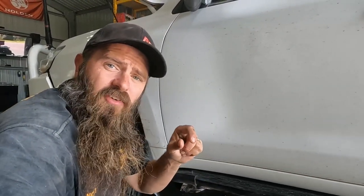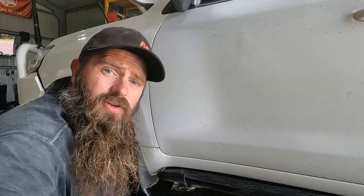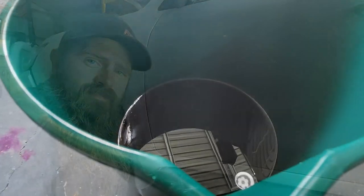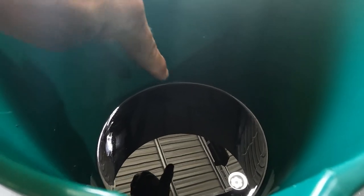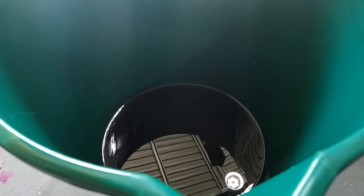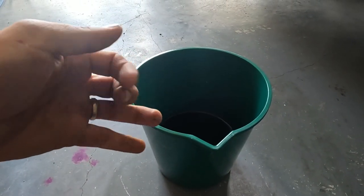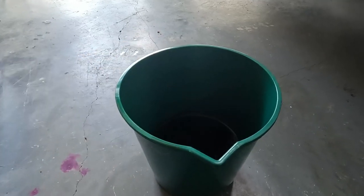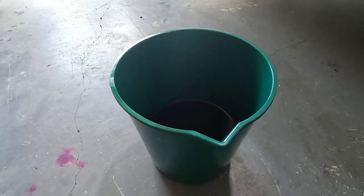While that's draining I'm going to go to the other side, disconnect the flush line, and put the original cooler return line back on. We've drained two liters out of the pan plus the two liters we pumped out — so four liters total we've got to put back in once we're done. Always good to remember your numbers.